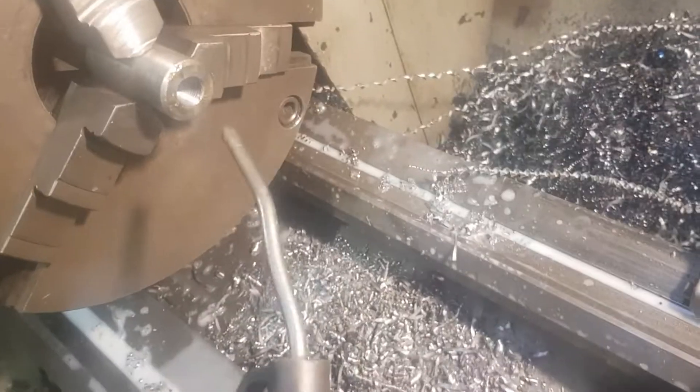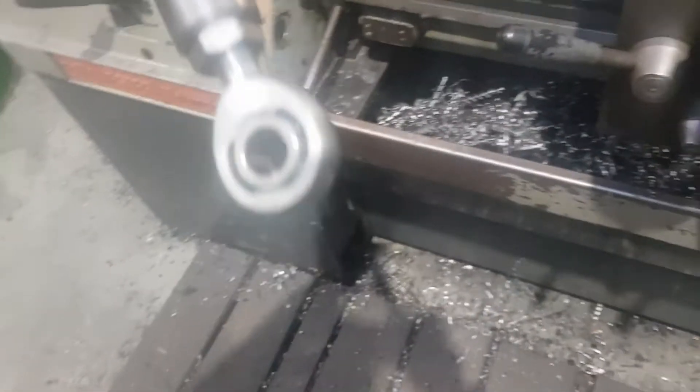As you can see here I'm drilling and tapping either end of this piece of medium tensile. When I tap it, I do one end with a standard right-hand thread and the other end left-hand thread, so that way when you turn the shaft in the middle it pushes the rod ends at either end out or in depending on what you want. It just makes adjustment a lot easier.